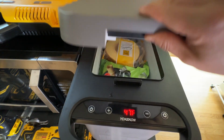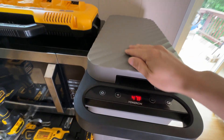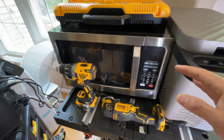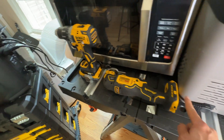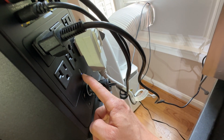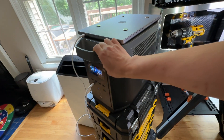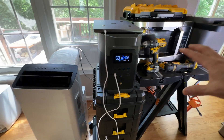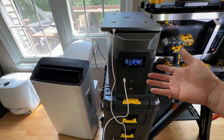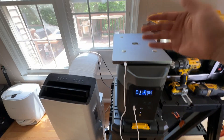The temperature is set to 47 degrees. I have eggs, cakes, all sorts of random stuff as storage. Usually when it goes to 50 degrees Fahrenheit, the fridge will kick in. It is connected using this cord as a DC input to the 12-volt socket back here, which is controlled by physical switches. The AC port is also connected by this switch. With this setup, if I'm not running the AC unit or just charging laptops or USB devices, it's going to handle that fridge just fine. For the past week it has fully recharged to about 85 to 95 percent just powering that fridge, given sufficient sunlight.